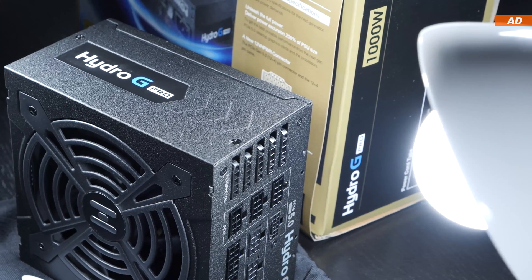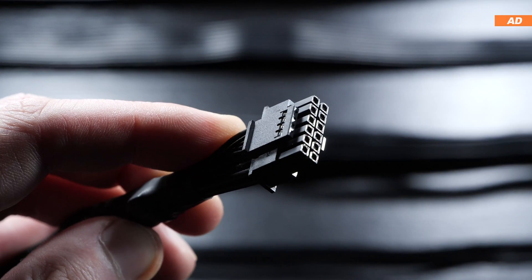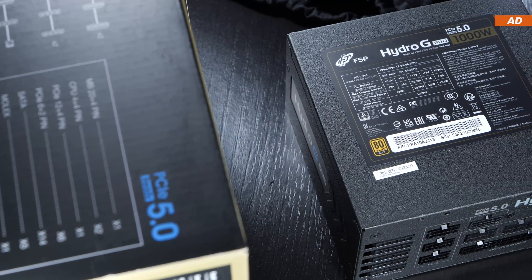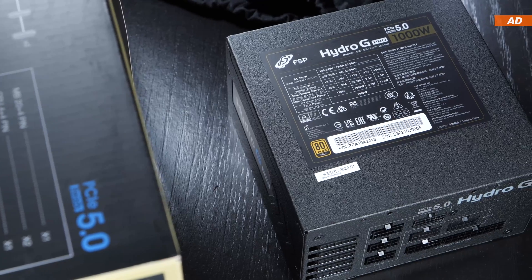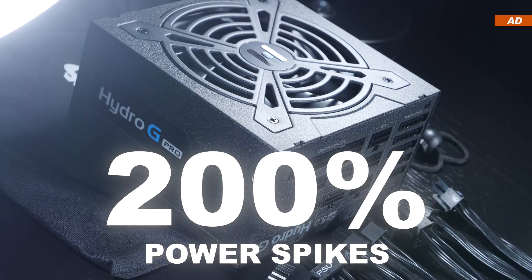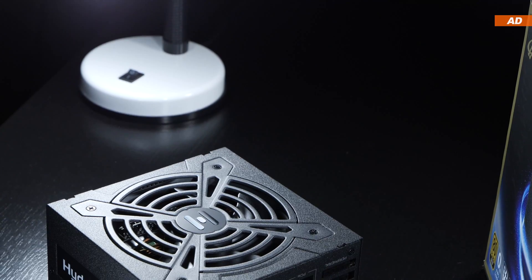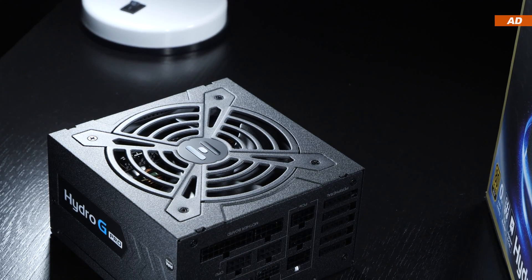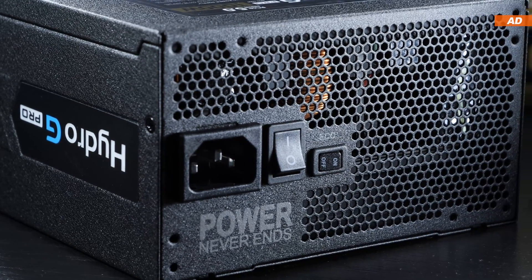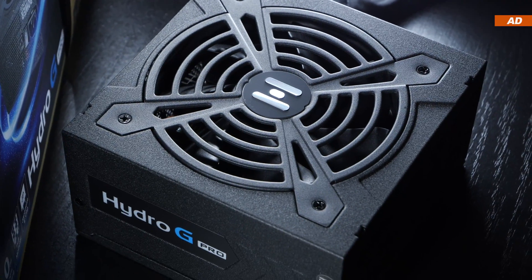So let's return to the question from the beginning — what are the advantages of ATX 3.0? In addition to the natively integrated 12V high power connector without relying on adapters, by far the biggest advantage is the significantly higher tolerance to power spikes. An ATX 3.0 unit can handle up to 200% of its rated load — not constantly, but this eliminates sudden crashes and shutdowns we're familiar with when combining older PSUs with newer GPUs. Furthermore, power efficiency at low loads has been improved as well. ATX 3.0 brings better stability, endurance, and in some cases higher efficiency.